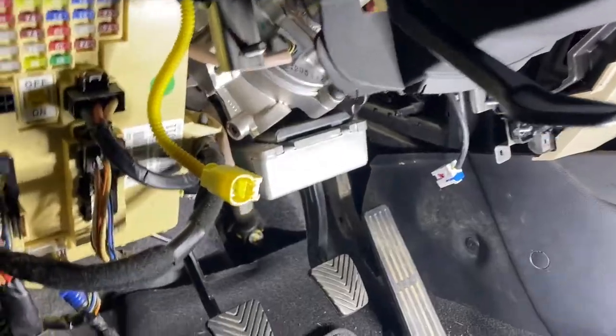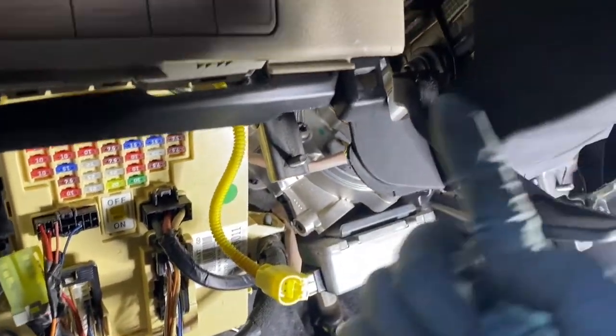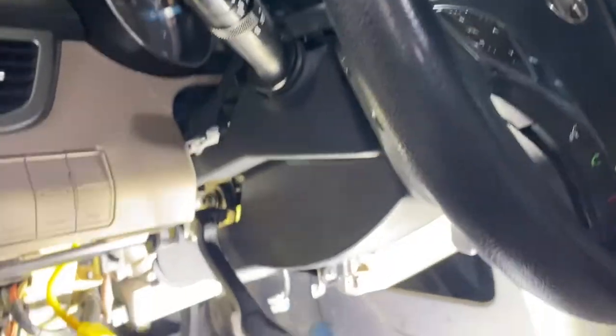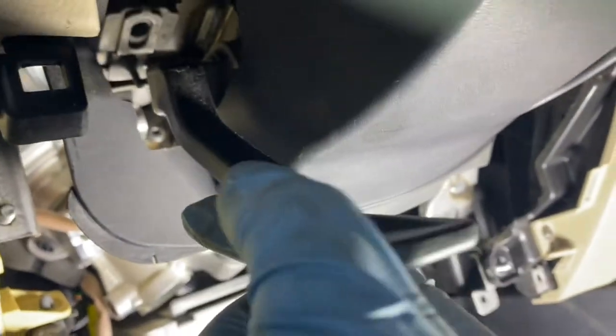Not too bad, right? Alright, almost done. Now that's in. All I have to do is torque it later, then we're gonna put these two nuts on. There will be a stud that you'll see is coming out, sticking out right there. That's my finger at. If you accidentally move this, this is like the steering angle, steering column angle up and down. That's fine. It does move a little bit, but make sure it's just aligned on that hole. Same thing on the other side.